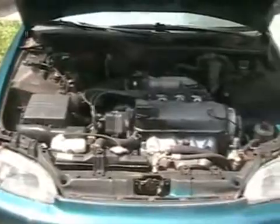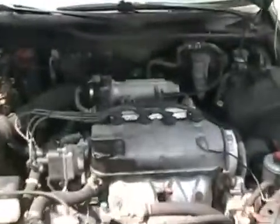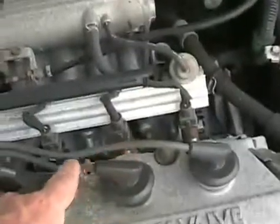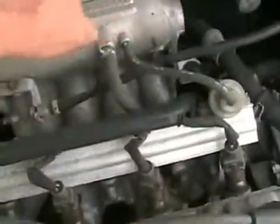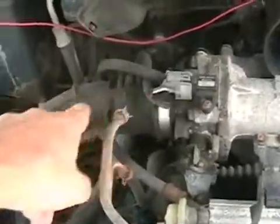So we have a typical stock induction system on this 1995 Honda. Multi-port fuel injection with the fuel feed rail. These long tubes are called runners. This air storage box is called a plenum. And people like to put shiny, smooth pipes in a different air cleaner box on the intake snorkel.